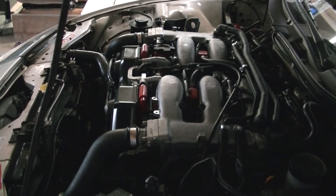Turning off cylinder one. Turning off cylinder two. Turning off cylinder three. Turning off cylinder four. Turning off cylinder five. And lastly turning off cylinder number six. The only cylinder that didn't change the sound of the engine was two, so let's do two one more time. I'm going to turn it off now, and you hear no change in the sound of the engine.